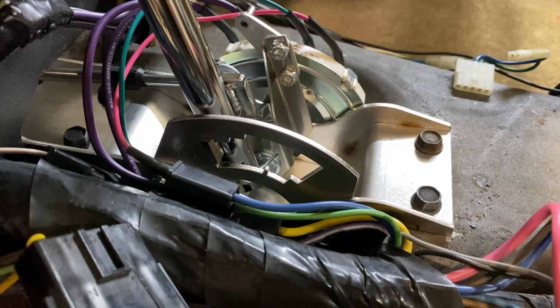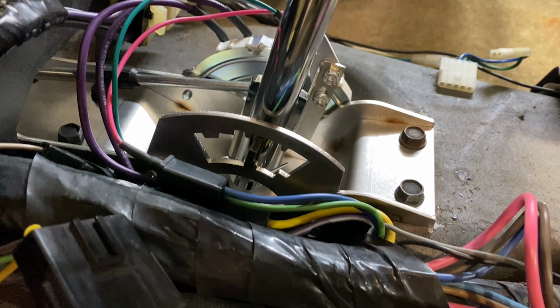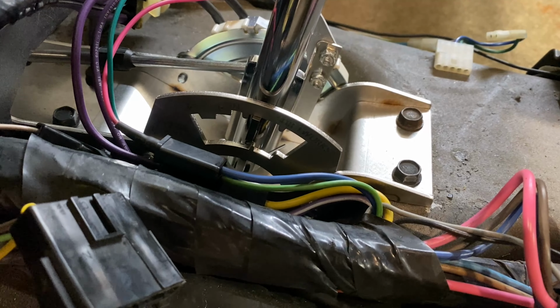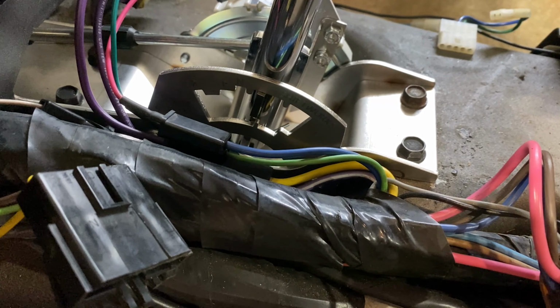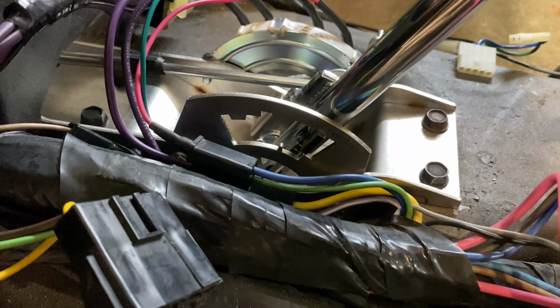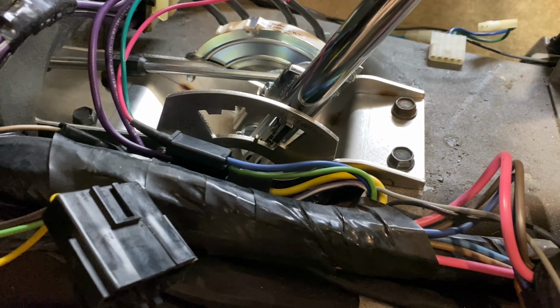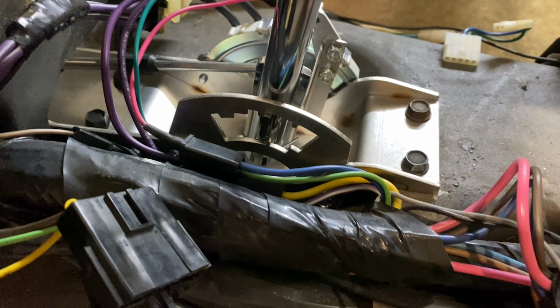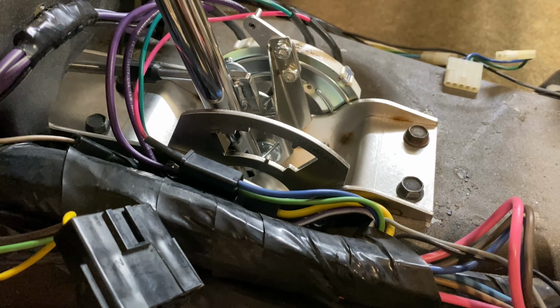And a nice feature of the slap shift is if you hold the button coming out of park, it'll stop for drive and then go into the notch as you release. Then you can go 3, 2, 1, and upshifting can be 1, 2, 3, 4th. We've got reverse. Everything's all good up here.